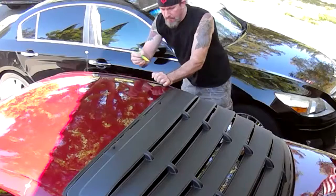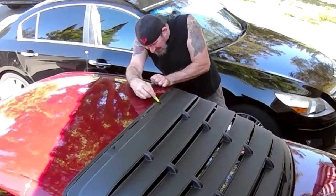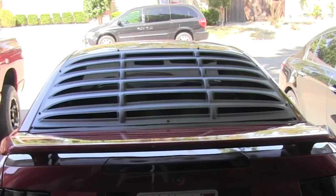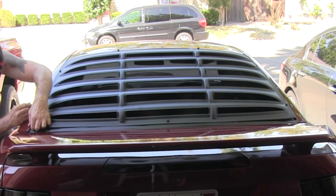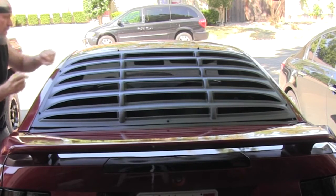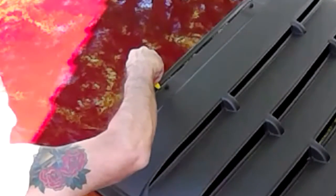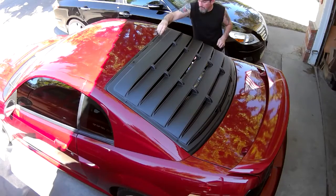Then I'm going to mark with my wax crayon. The top hinged brackets are the most important — you want to make sure you get those perfect. I'm marking all the way around the bracket to make sure I get it just right. Then I'm marking the side brackets; all I need is the mark of the width of the bracket. I'm marking on the car body, and the wax crayon will just wipe off. Making sure I get those top brackets marked perfect where they're going to be placed.